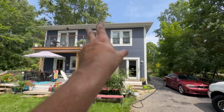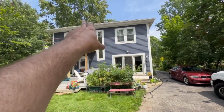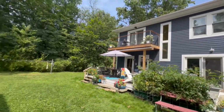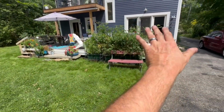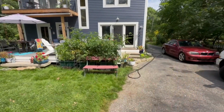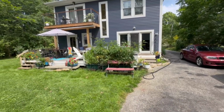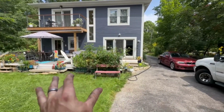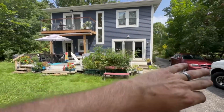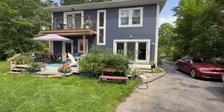The other thing is it's supposed to rain at 2 o'clock, and I'll go up there. It'll be a little bit cooler, and I'll see if it's leaking. If it is leaking, it's due to my screw-up where I positioned it too close to the roof, and then I had to move it over so the shingles aren't right, and I wasn't able to peel the shingles back. These are triple-ply shingles, and they're weird. They're two dimensions. Normally it's a shingle, a shingle, a shingle, but this is a shingle and a shingle and a shingle, and in some places it was 4 shingles thick. I couldn't just roll it back like the manual suggested and then nail it in there. So I got nails at the top and a lot at the bottom, and it's just not 100%. Plus the way I cut it moved, and I don't like the way the shingles are. Long story short, too late now, I think I can put some flashing tape around, some really sticky stuff, and black. It's not like people go up there and say, hey, your roof was ugly. That's assuming it leaks. We'll find out. 2 o'clock, rain.